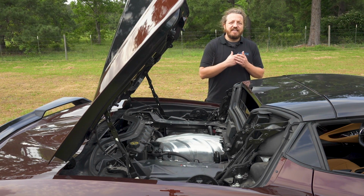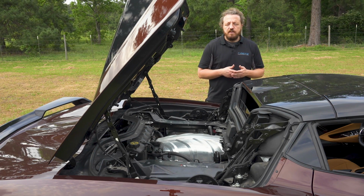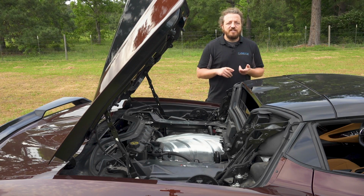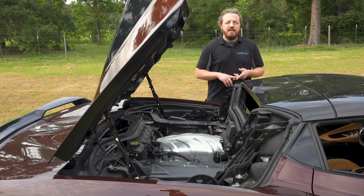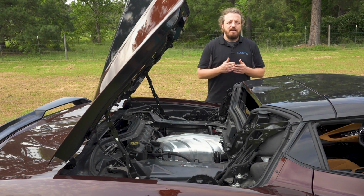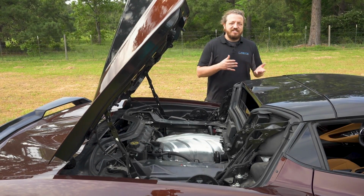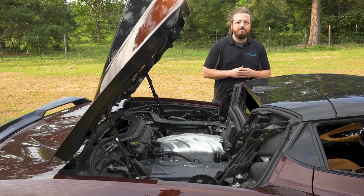Beyond that, we have a camshaft from Brian Tooley Racing. This is our spec camshaft, and also we have upgraded components for the valve train, such as C8 trunnion rocker upgrade, hardened pushrods from Manton, amongst many other things like dual valve springs and some other goodies thrown in there. So that's really the basics of the engine and the cylinder heads and the cam, and now we're going to move on to some other components that I want to highlight for you.